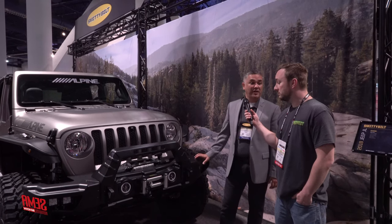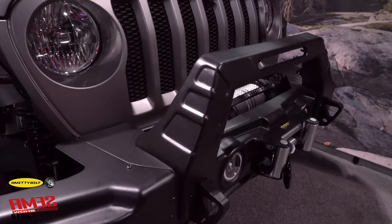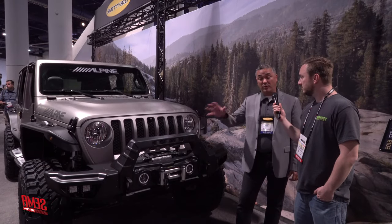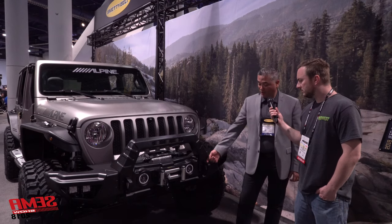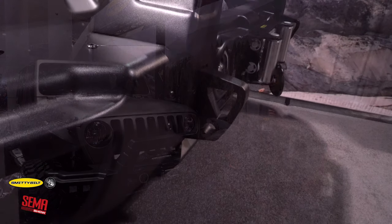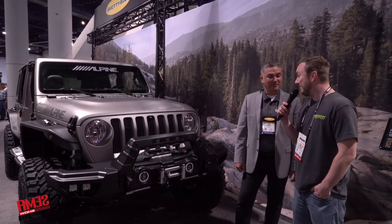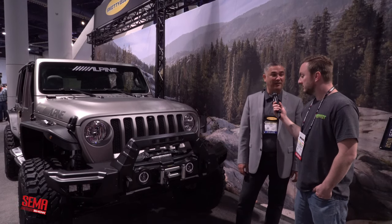These wings you can take off and it becomes a rock-crawling stubby bumper. You've got the look you've come to expect along with Smittybilt value and durability. It's about 3.5 millimeters thick, deep draw — strength equivalent to, if not a little bit more than, OE. The winch plate comes included, there's a spot for your factory fog lights, and on the D-rings there's a hole for your D-ring shackle. This triangular cutout is actually for a trail jack, so if you break down off-road you have a place to safely capture the jaw of your trail jack.